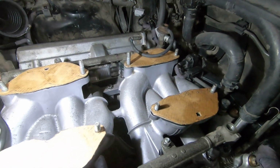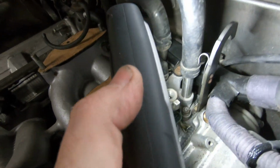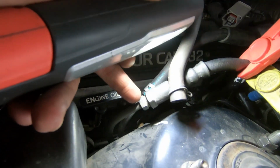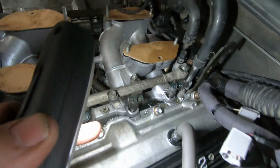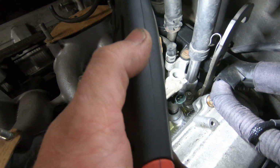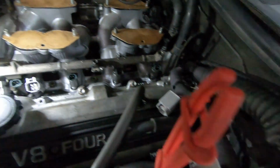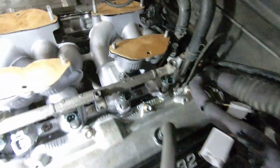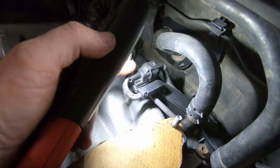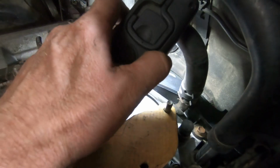As you can see, I've dropped the whole top plenum off. So that was nice and simple. Fuel line. Often these fittings here are a bit funny. So I just pop the dampener off, the fuel rail, and make sure you get your washers around the correct way. Again, loom all out of the way and just pulled out of the way so it's not in your way at all. Here's your start trigger connector, which has also got the 2 knock wires in it, so located at the back of the engine.